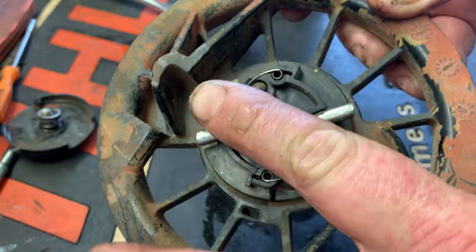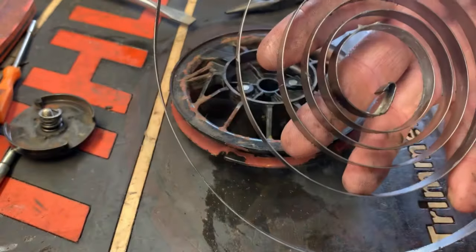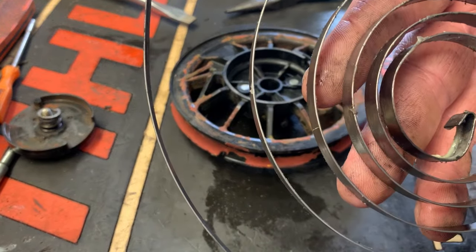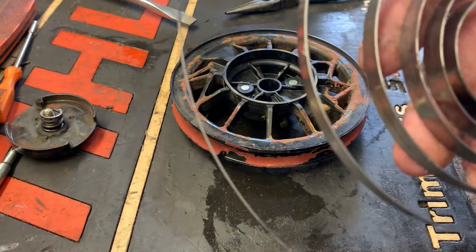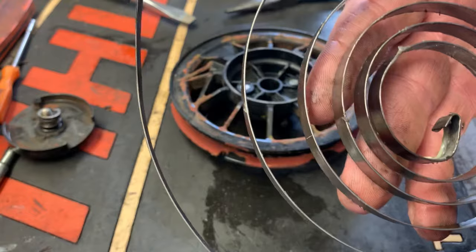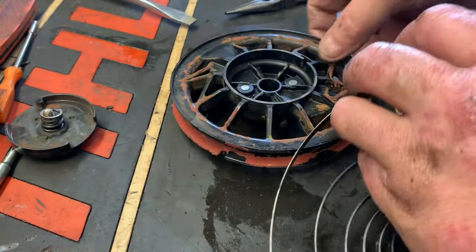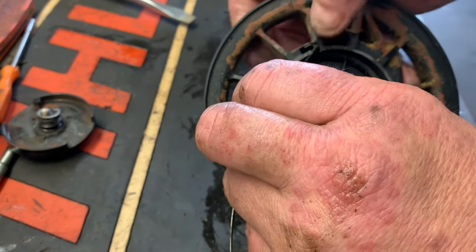Be sure to put your fingers over this to keep these from falling out. So we've got our new starter spring — it's already got grease on it, you don't have to lubricate this. I'll put a link in the comment and in the description for the spring for a Honda. I'm going to put two or three different springs in the comment and the description to cover a few of these engines. Basically what you need to do is start right here at the outer end of the spring, not the inner, and we're just going to hook right back into the starter rotor.